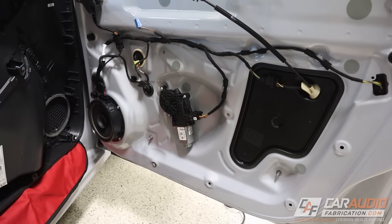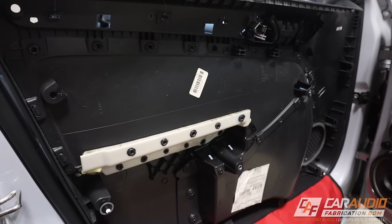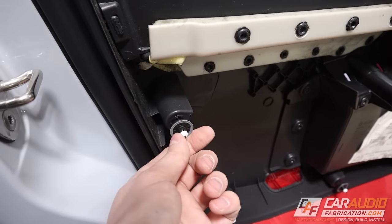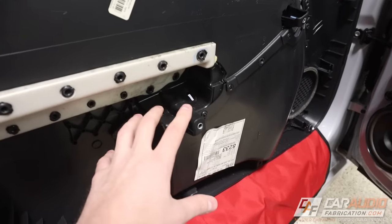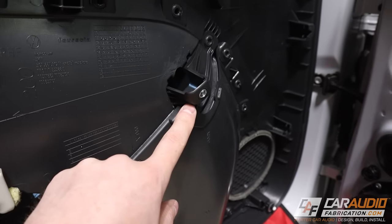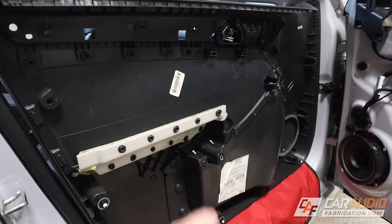On each of the doors there are three main areas that we need to tackle. The first area is the back of the door panel itself. The door panel is made of flimsy plastic that is prone to vibration, so we're going to want to make sure that on larger flat areas we apply the materials. We also want to look for sources of vibration like clips and make sure that we isolate the different materials from each other. But we want to make sure we do not put material in areas that will mess with the fitment of the panel back onto the door, such as where bolts come through, or anything that moves like the door handle.